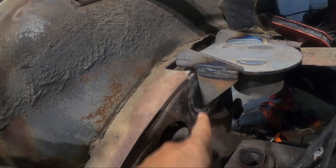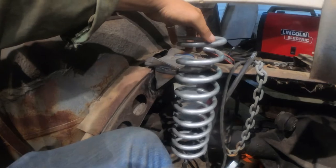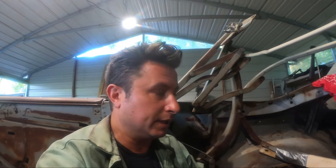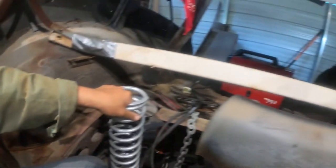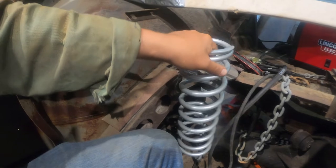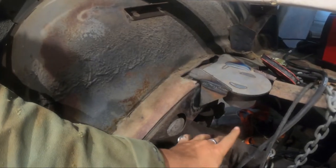That bracket fits and we can now weld right here where we couldn't before because there was a big hole. I've done my research, and with this spring rate — the spring rate offered in the kit — using a chart that Speedway made about spring rate compression with the weight of the car and rear end, they actually had a chart that included 46-through-48 Fords and their weight. What that told me is with this 14-inch spring, with the weight of the car in neutral position, it will compress four and a half inches, leaving us somewhere around eight and a half to nine inches. Nailed it.